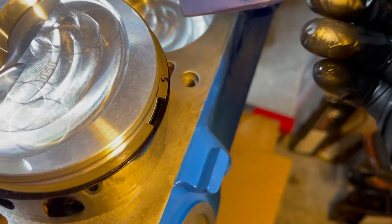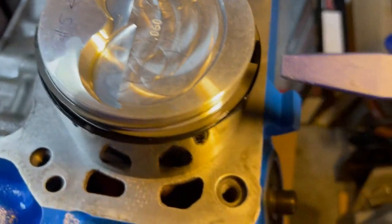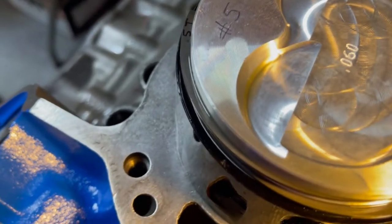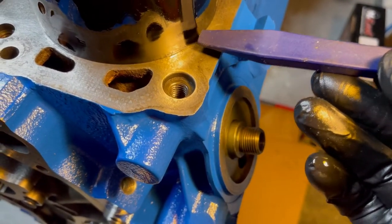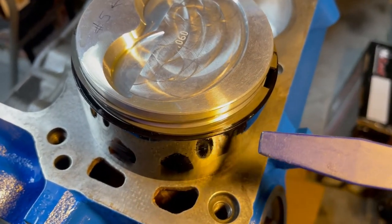I'm not using a lot of pressure, and once you get all the way around you'll feel the whole thing seat — then you can push it down. The oil ring goes in fine; it's just the other two. This compressor works great. Once I get the piston in there I keep a lot of pressure on the ring itself because I don't want any little gap for the ring to pop out — when you're tapping it down with a mallet, that's how you'll break a ring.